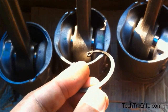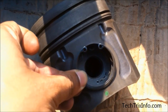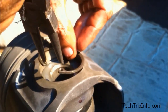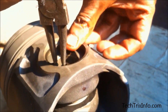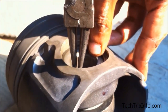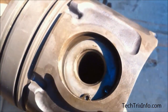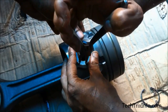When the circlip has been pressed and released, we can see how it has been done. That's where we will be inserting the circlip with the help of a circlip plier. The circlip plier will be aligned to both holes and we'll press it so that the diameter reduces, then insert it into the slot. Once it is inserted, we release it — when we release it, it expands and locks everything in place. That's how the gudgeon pin gets locked.